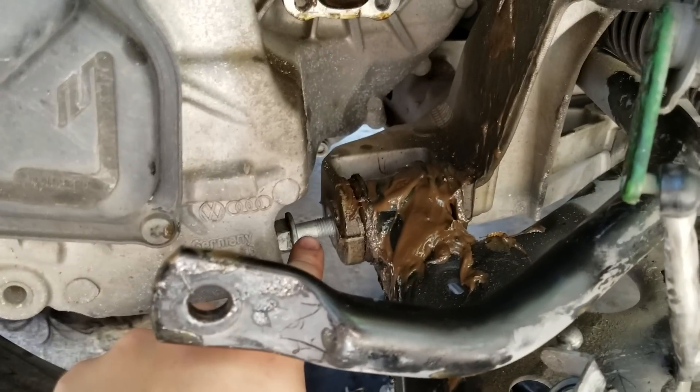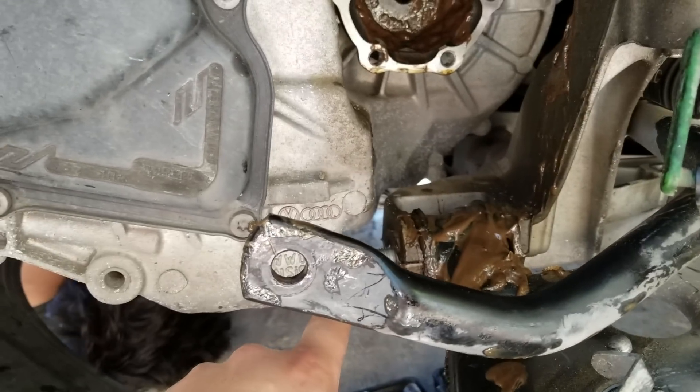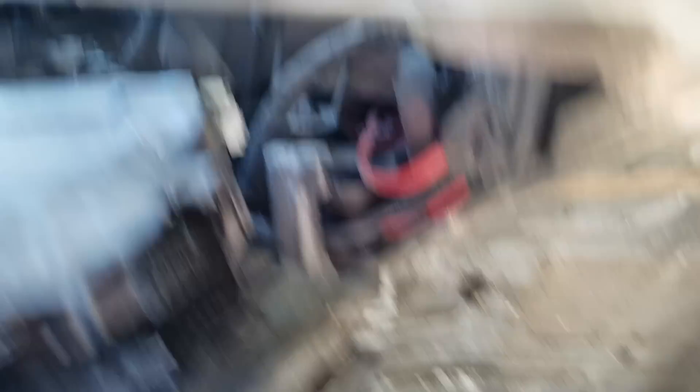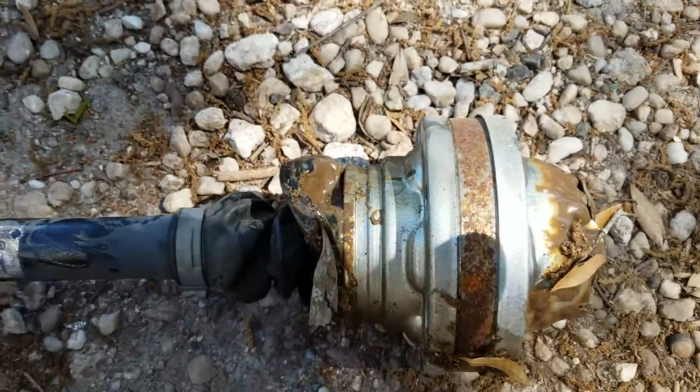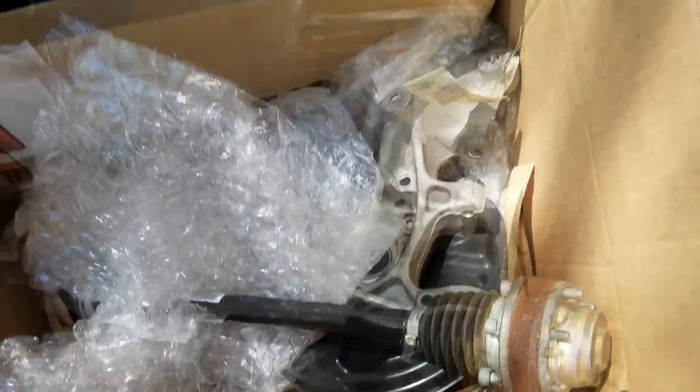No cursing on YouTube, Mike! We have to drop the K-member because it's touching the transmission housing. You see all the grease from the CV axle over here. I ordered a replacement, which is right here, but they sent me the rear — anyway, that'll all get taken care of. Basically, get the control arm out, we got the axle out and the knuckles out, and then we just put everything back together.